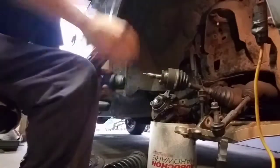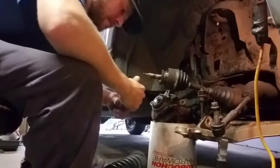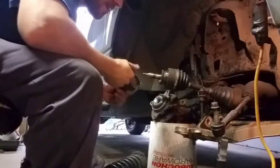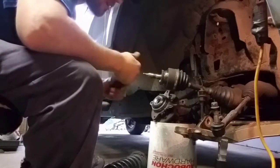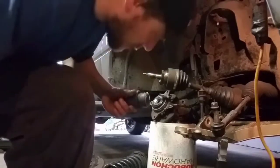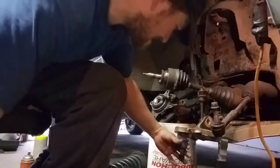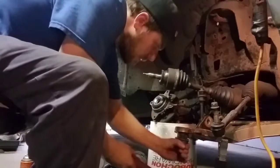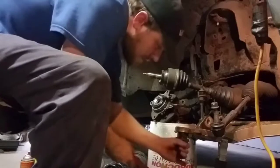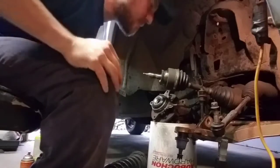There. Now, all we gotta do is take some expired grease, Tribology food grade, from a certain unnamed previous employer. Lube this guy up a little bit, since we got the bore extremely hot, and we got the new ball joint extremely cold. This should do exactly what we need it to do without a pressing tool, in theory. Okay, well, apparently not theoretical enough. Let's try some extra stuff, some extra hack methods.